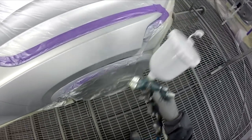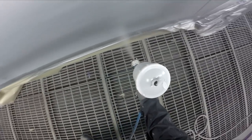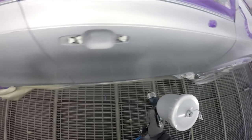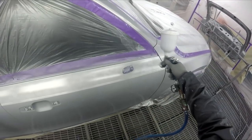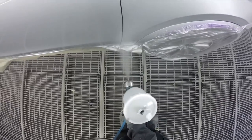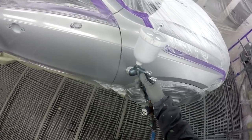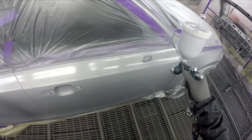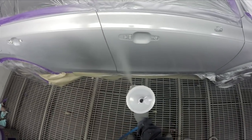I've got some slow and fast thinners in this one because I didn't want it to go dry on me too quick - it's a reasonable sized job. I'll do two panels and then go back to the start. So that's the first coat - I didn't go quite wet enough on the first coat. This is my second coat, the drop coat. Holding the gun right fast can be hard - colour's gone up there but it's all good, the colour's actually really good and we're painting the whole side. I'm confident the colour's going to look nice up to that guard anyway.